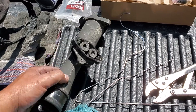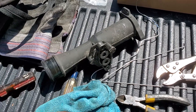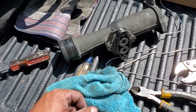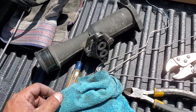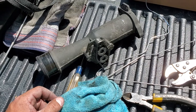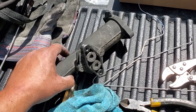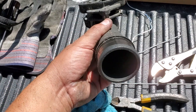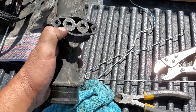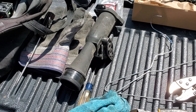Now we've got air passage through both ports, so that should clear the code. Another reason for this video is that more than likely a shop won't take the time to take this apart, clean it out, and get rid of all the buildup — and you'll keep getting codes after that. If you do it yourself, it's real simple: two bolts and a clamp like a radiator hose, two bolts for the sensor. It takes about ten minutes to take it all out.